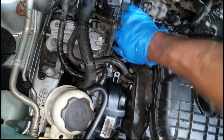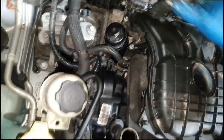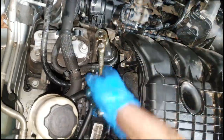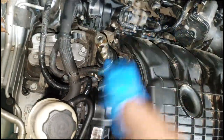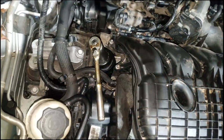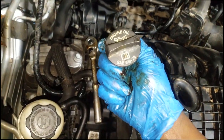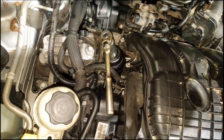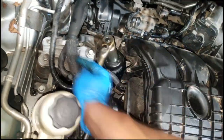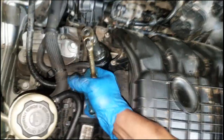I am in the last stages — oil filter going on. As you can see I have my bleeder funnel here where I'm bleeding the cooling system. I'm going in with new five-year Mopar coolant, and the oil I put in is 5W-20. The brand we use is Valvoline here — Valvoline makes some good product. I have now jumped on the Valvoline bandwagon.